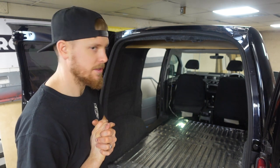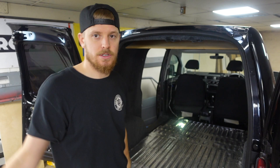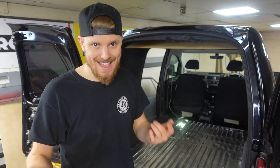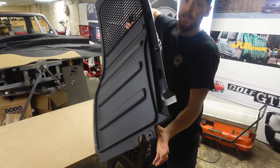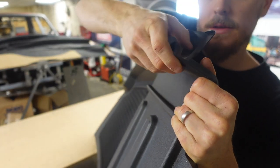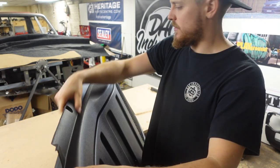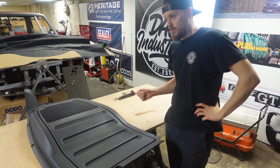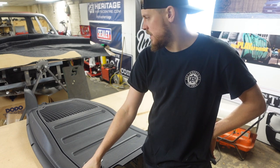I said in the last one that I thought I'd come up with a brilliant idea and it turns out people have been doing it for years, so that's what we're going to do. I've offered in the hardboard roof panel just to check the way that things go. We've got the original factory bulkhead which is constructed in a way that this piece and this piece come to a very nice little point. So if we follow this line and cut all the way along here, we'll get rid of this piece and it will leave us with a nice trim piece that we can carpet. The compressor is just filled up finally — I'll go around with the air saw and cut this edge off, then tidy it up with a sander, a Dremel or something.